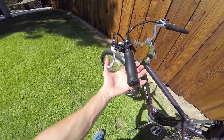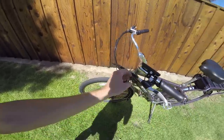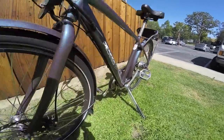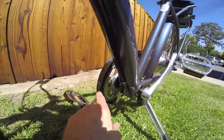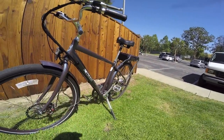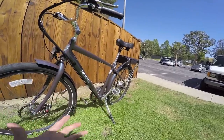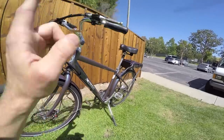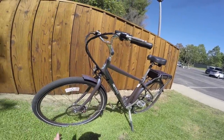There are oversized rubber-coated brake levers from Tektro with an integrated bell — love that. They do have the motor inhibitor, which is awesome because this is a pedal assist bike using cadence sensors. There's a plastic disc with 12 magnets that pass a little sensor, and that's what tells the motor to start and stop in pedal assist mode. There's a delay between when the magnets go by, so if you really need to stop you want to hit these brake levers — you don't want the motor fighting you. They do an excellent job of immediately killing the motor.